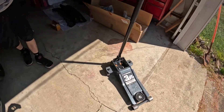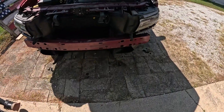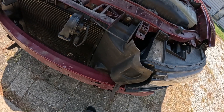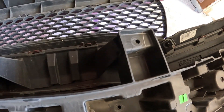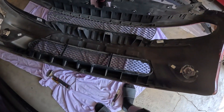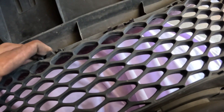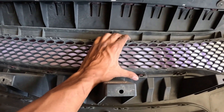Now we're going to try to take the bumper apart and put these pieces in first because that'll be the hardest part. Right there you got a plastic pin, and then four right here, and you can lift this part up. Then the top grill — this pin right here, these tabs you just pull them towards you and push up from underneath. If you have two people, one person can pull back and the other person can push up from underneath.